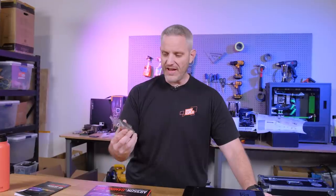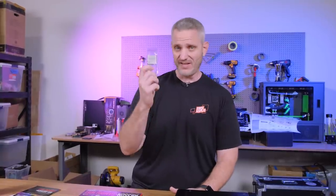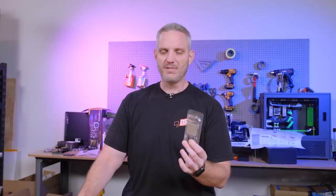I'm going with the APU — this is the AMD Ryzen 3400G. It really is the best we could possibly do for this build that still allows us to do any sort of gaming with the power limitations of this power brick. The 3400G is literally a bastard — it doesn't truly belong to any family. It's not a true 3000 series CPU even though it says 3400G, because it's still Zen 1.5, based on 2000 series CPUs. And as much as we've been begging AMD to come out with an RDNA-1 based APU, this is still running Vega graphics — but it's still better than anything Intel has to offer on desktop APUs.